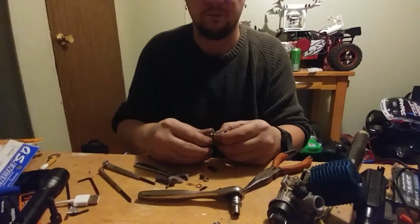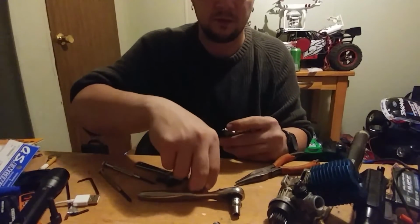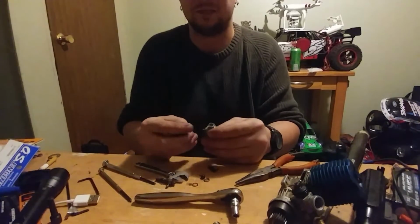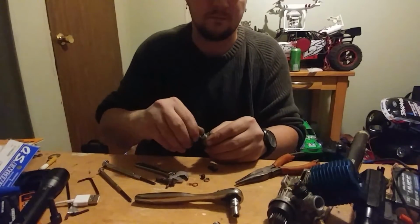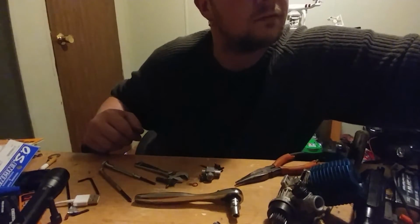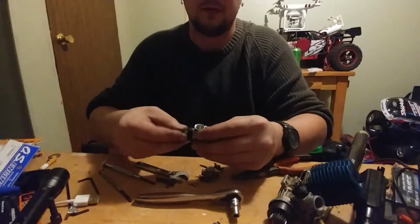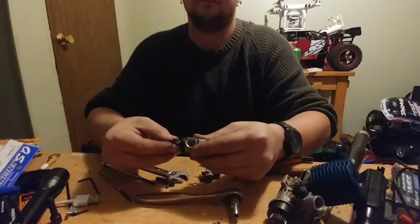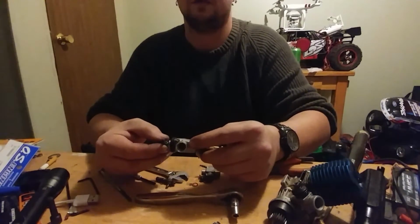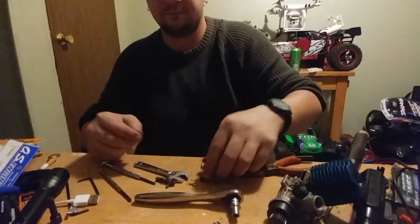And again, you have a groove. That's where the idle screw rides. Some of them are actually cut at an angle, so it'll sort of slide out like a slide type carburetor. Like this one right here, the Super Tiger. When I rotate it, when I open it, you can actually see it slides out some, because it rides on right here. This is the idle set screw, the idle gap. It not only rotates, but it slides out some.